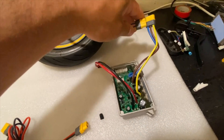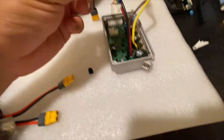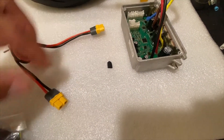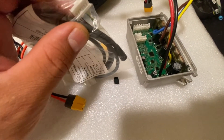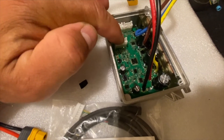First you're going to connect your motor to the MR60 connection, and then get your wire from the motor which is the hall sensor and connect it right there. Then you're going to connect the wiring which goes to the dashboard — connect it right there to that port. Mainly what you're going to be connecting in this part is just the motor and the dashboard, nothing else — that's all you connect to it.